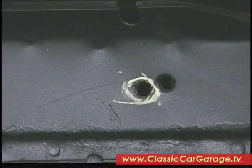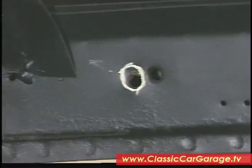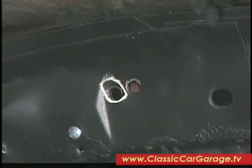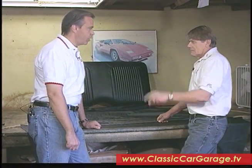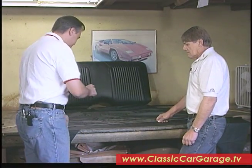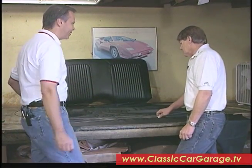There are a series of holes where the bows secure into the car. You want to be certain you get them in the same holes they came out of, because that will determine the arch or the length of the rod. Also, in the car, we've made chalk marks to show where each of these bows go. The next step is putting these bows through the listings in the headliner.